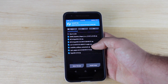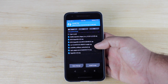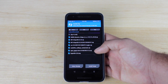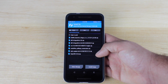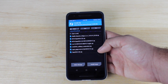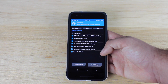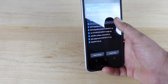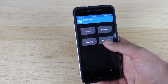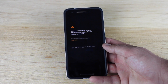All it includes is the Play Store, but from the Play Store you'll be able to download Gmail, YouTube, and any other Google service that you need. All other GApps packages I tried failed — they would not install and would give me an Error 70 message. This is the GApps package I found to be working. Once you have all of these selected, swipe to flash. When it's finished, reboot your device, and if all went well you should be greeted with the CyanogenMod 13 boot animation.